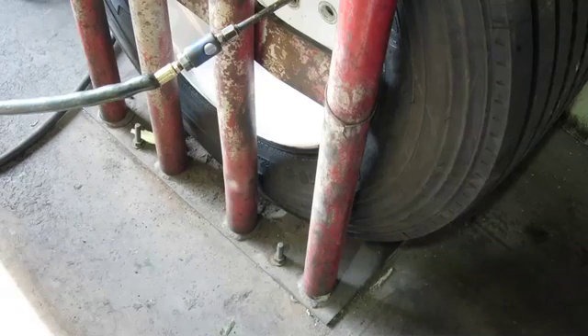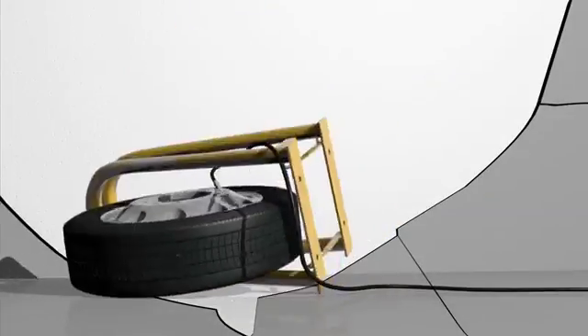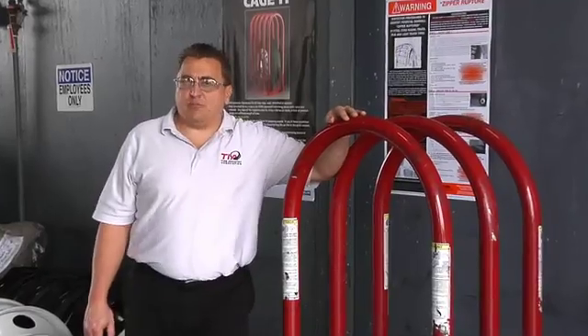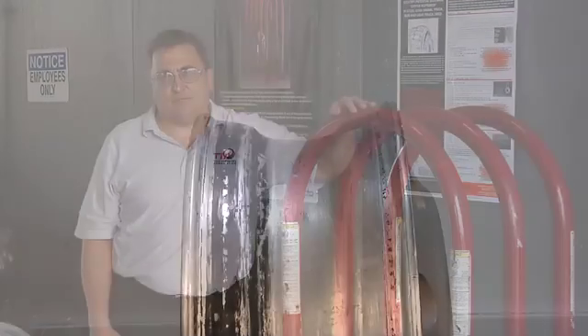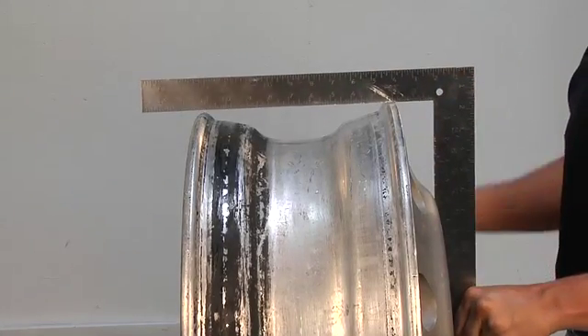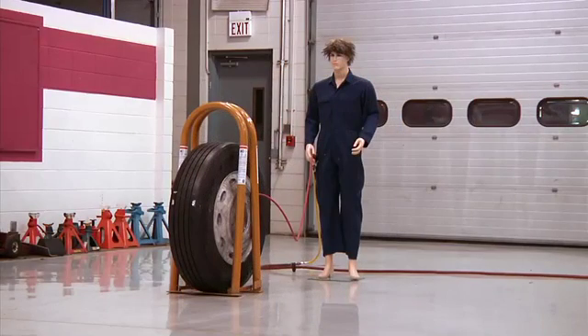And to make matters worse, the device has been bolted to the floor, so the bolts can become shrapnel if the metal wall doesn't collapse first. A restraining device is designed to absorb the energy and prevent a tire and wheel assembly from becoming a projectile during inflation. For example, if a disc wheel is damaged by excessive heat, the rim diameter on one side becomes smaller than the other. In this controlled test, a tubeless truck tire is inflated on a heat damaged wheel.